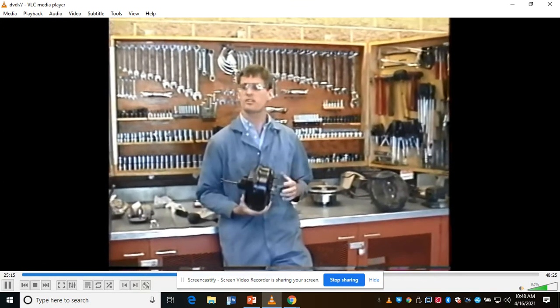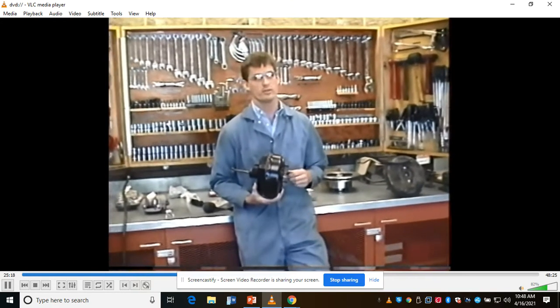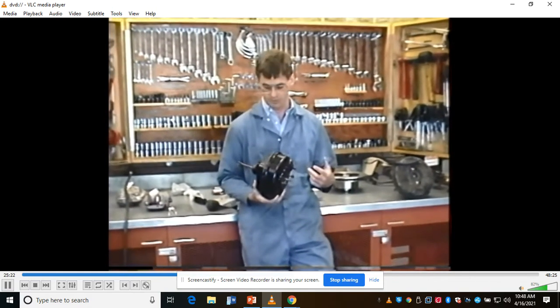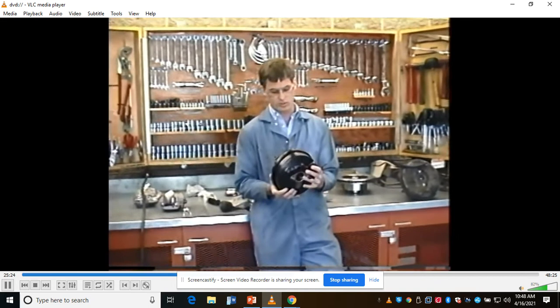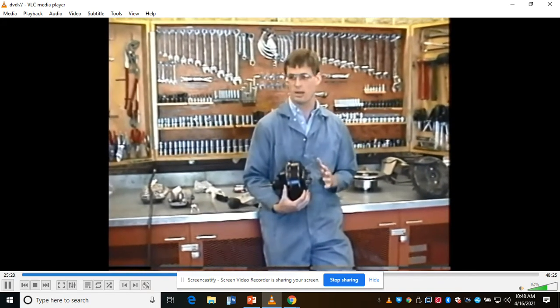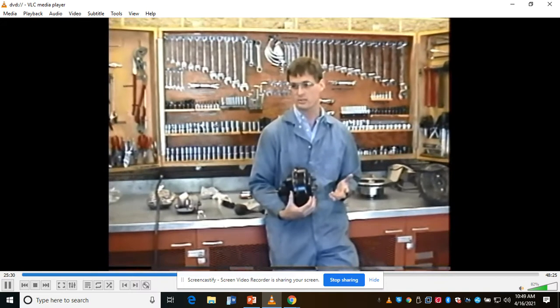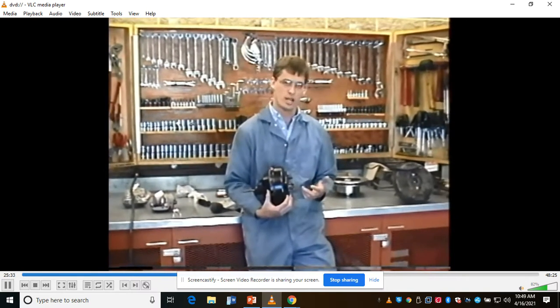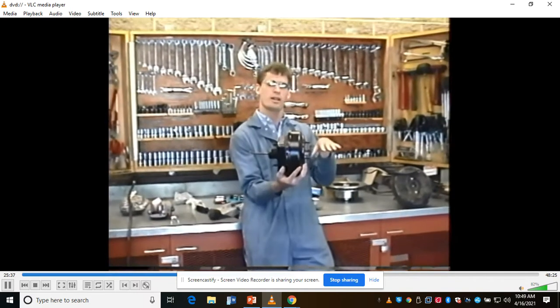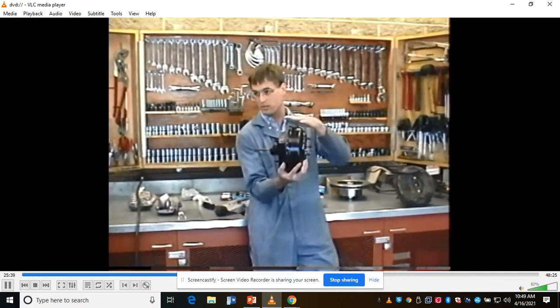I don't want such a sensitive brake pedal. My wife drives the car, wants something a little bit more user-friendly, instead of somebody getting in and hitting the dash when you brake. So I went to the original one because it's a smaller diameter, it won't give you as much power assist. I hope I'm correct in my assumption here. Yeah, I could always change back, but I'd like to try and use this one. The other thing is, because it comes out straight, I don't have to do any modifications to clear the hood.